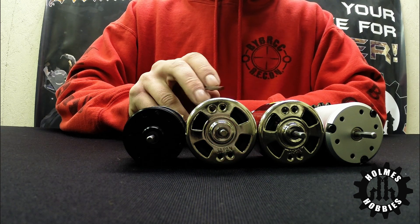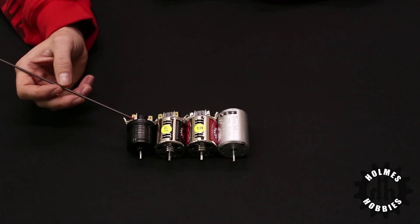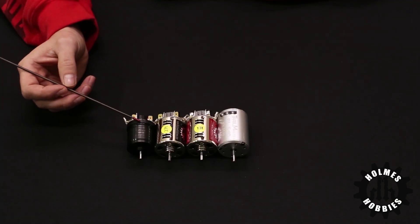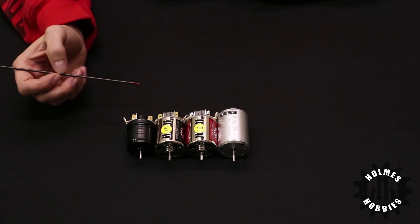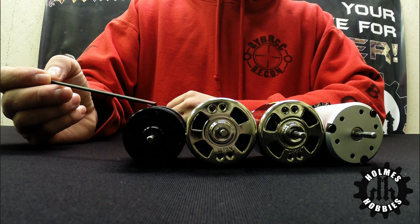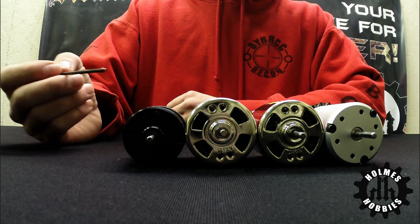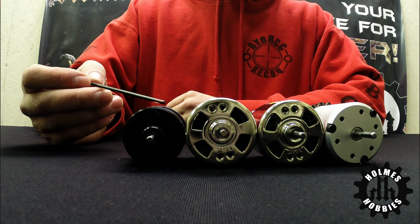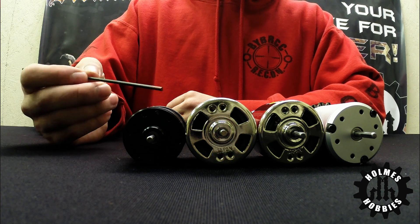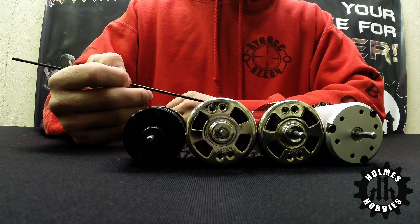Both will be well suited to most rigs. We also have our Puller line, which is typically a little smaller because it uses neodymium magnets as opposed to ceramic magnets. The turns on this line are the same as on our TorqueMaster or Crawlmaster versions, so you may find yourself choosing a 13 turn crawl type or a 27 to 35 turn torque type of the Puller motor.